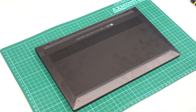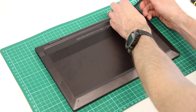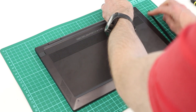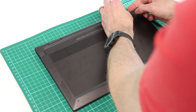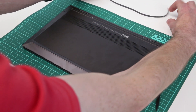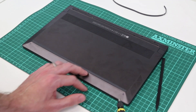The first thing we are going to do is flip the laptop over. Having done that, we grab our pry tool. For this particular chassis, we do not need to remove the bottom rubber strip — we only need to remove the one at the top of the unit. There is an adhesive strip on the bottom of this which we're going to pull up, as it makes things easier when fitting the screws through afterwards. We then have five screws: two at the base and three under that strip.